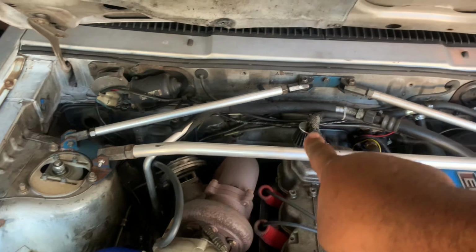So, long story short, this motor's gonna come out, right? Also while we're doing so, because I've been procrastinating about this for quite a bit of time, this engine's lasted almost 9 years on a stock bottom end and used piston rings, which I'm not too sure where they came from, but I found them in a bin already on some pistons, and I threw those into this block with new main bearings, new rod bearings, and a polished crankshaft.